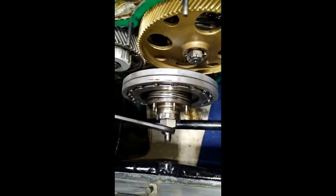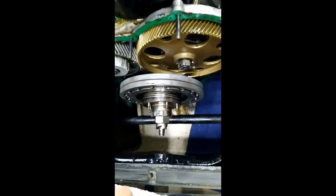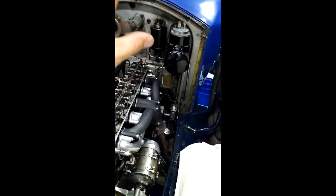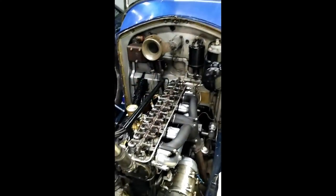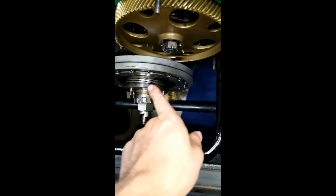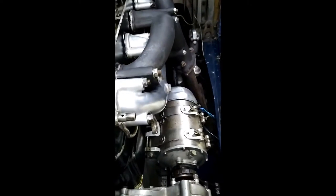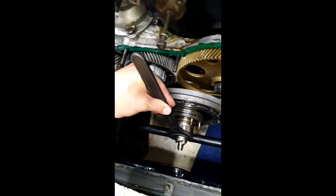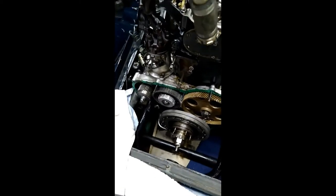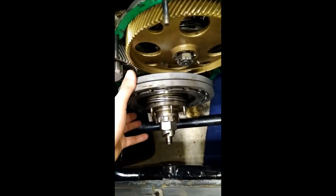Here is my spanner — I'll fit it onto there and you will see it draws in. Wind it all the way in and as you feel it get very tight, stop. Put someone on the flywheel to sprag it and hold it in position. Then tighten the captive nut first — remember it is left hand thread so you tighten it that way. Then span it on, check that the crankshaft is spragged, and knock it with a firm whack — as suggested in the Haynes book, use a two-pound mallet. A fair whack will lock the slipper drive into position.